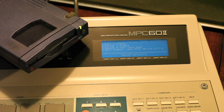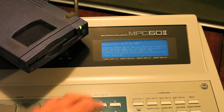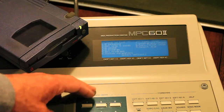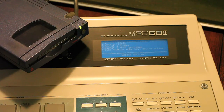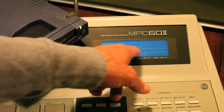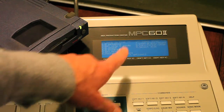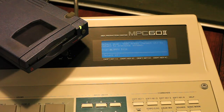You can go to 4, SCSI status, make SCSI device active, and there you choose the device address, and once you do that you make it active, and once it's active you'll go back and you'll format. I've already formatted. And you'll format a SCSI hard disk. Once you do that, it'll be available in the select disk. So I have a 100 megabyte zip in here, and I get 4 25 megabyte partitions. Alright, thanks for watching.